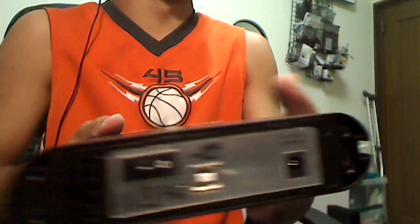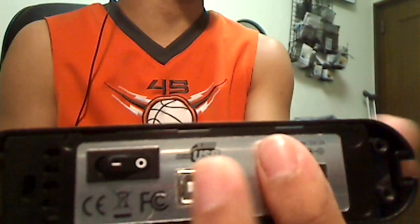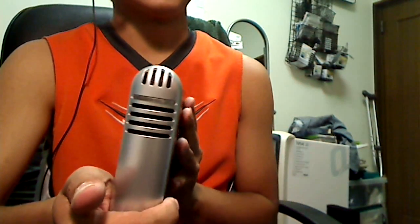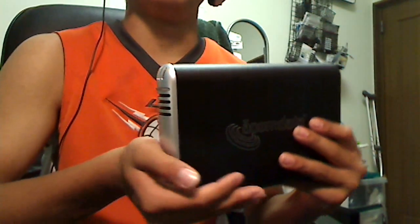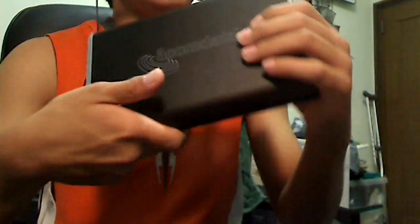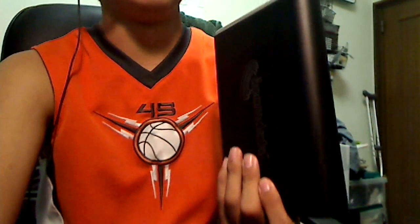You would put the cover back on and screw it in. Then you plug in the USB cable that comes with your enclosure, put the power adapter in, and power it on. Windows should recognize it — and if you have a Linux machine, that works as well. You can plug it into any OS and it will detect it as a hard drive. From there, you can go in and take your data out. Really, really useful tool for tech repairs, technicians, and geeks. Great thing to have around if you ever get spare hard drives, or somebody wants you to rip data off or check what's on a drive — much quicker than opening your tower. External hard drive enclosures, check it out. Hope you guys enjoyed this quick video — I'll catch you in the next update. Thanks for watching.